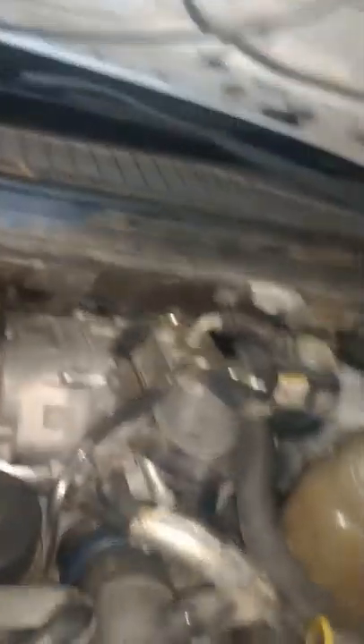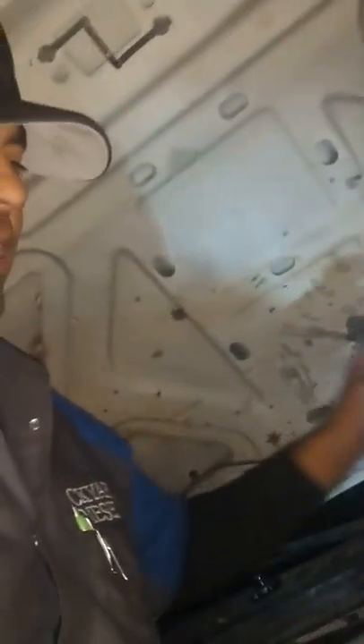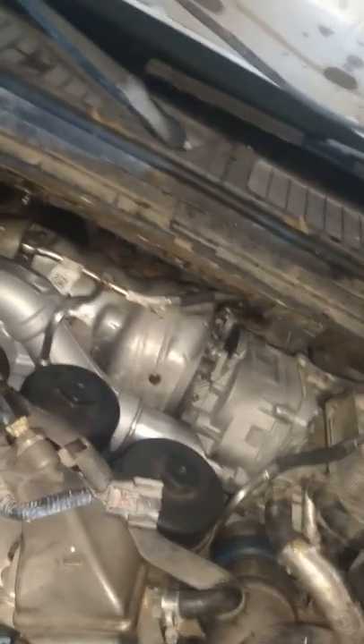Hopefully this was helpful for you guys. If you have any questions or concerns, give me a holler. So, four possible things — actually a little more than that — could have caused this problem. Could be a cracked head or something like that. My recommendation on this for repairs: front cover, water pump, and now that I know it's got mixture in there, I'm going to recommend changing out the oil cooler as well. This guy will most likely go for it — I'll just go ahead and replace it. But if you're budget-wise and money's tight, it's up to you.